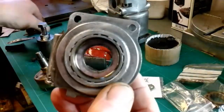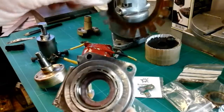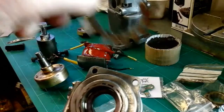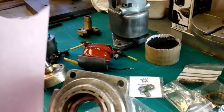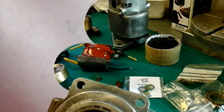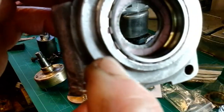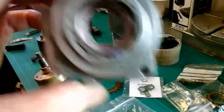I've put a new outer bearing in, same as the one on the other side. On this outer bearing they have to be insulated, and this is what Lucas used — a fancy insulating washer. Now you can buy them, but what I've done is copied around the old ones. I've made two new ones out of this Nomex paper which I had to do my armature rewind. So I've made two new insulating washers — they're already fitted there. So I've got my outer bearings in.